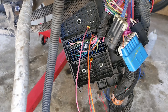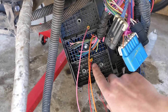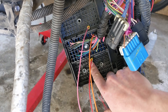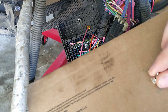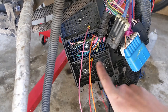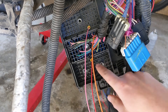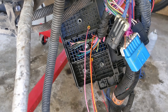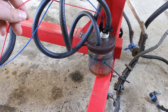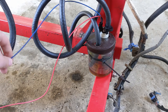The last thing you need is the 12 volt output to your fuel pump. That is on connector block three, pin F1. When the ECU turns your fuel pump on — so if I switch my ignition on, it turns that fuel pump on — it's going to provide positive 12 volt output on pin F1 right here. I just threw a spade connector on it and ran it back to my fuel pump. The other end of that 12 volt line just goes to the fuel pump, and then I've got a ground wire going back to the ground terminal on the battery.